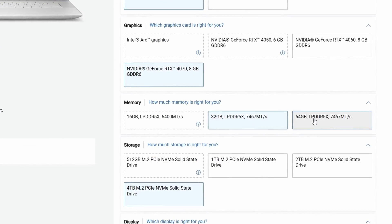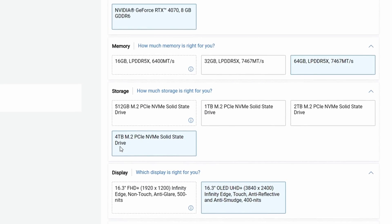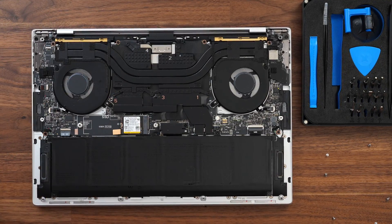When configuring, you can get both of these laptops between 16 and 64 gigabytes of RAM and 512GB up to 4TB on the SSD, so they're both exactly the same there. Do remember these are Core Ultra CPUs, so the RAM is soldered in — make sure you choose the amount you need when buying. The SSD is one M.2 slot on both machines and it can be upgraded.